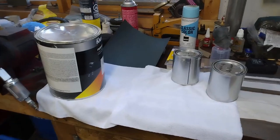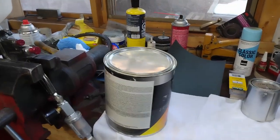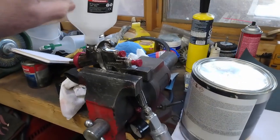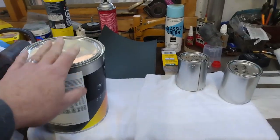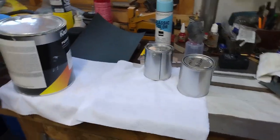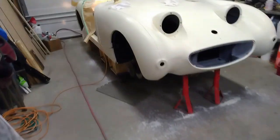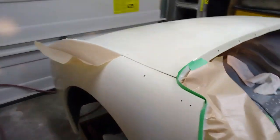I think I'm just about ready to mix paint up and get going here. The garage is up to a very comfortable temperature. I've had the gun itself in the house too so it's physically warmed up, and I've stored the paint, activator and reducer in the house as well. Compressor is all charged up. I've wiped everything down with the tack cloth where I'm going to be painting and the back of the car is warm to the touch, so I'm quite happy with that.